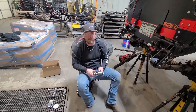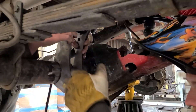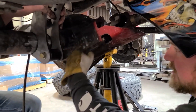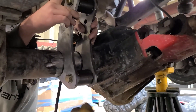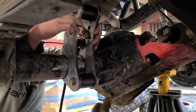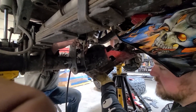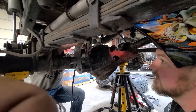Next part is tacking them in place and making sure that we got them where we want. With the help of a helper, make sure you got your axle side where you want it. You want your lower link to be a little bit below the drive shaft, and the upper link obviously is going to be where it's going to be. So now I'll just tack this in place enough to hold it, just in case we do need to move it again. For final installation, also make sure you put your bolts the right way because you can't normally get the bottom link on. We'll tack this one up and move on to the front.